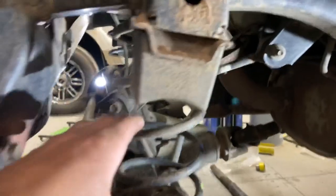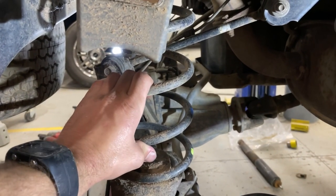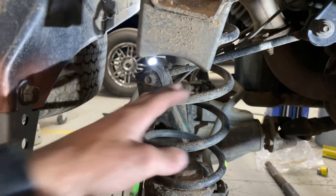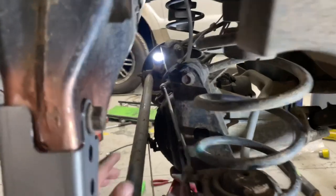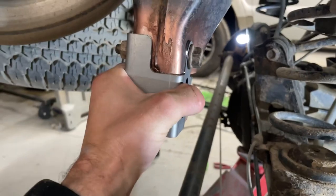Back here, my dad is working on the rear brake line extension and I'm working on the panhard geometry correction kit. Basically it's just a bracket that welds on and corrects the geometry. I also got different lift springs for the rear — I think it's about a two and a half to three inch lift — they're stiffer. You can see the extended brake line there, it was pulling tight, and this is the panhard correction kit.